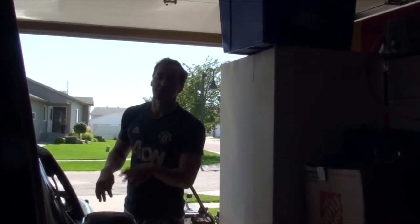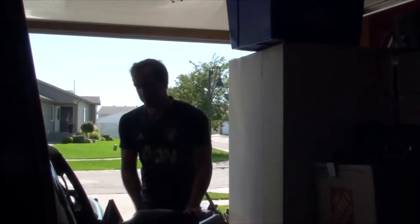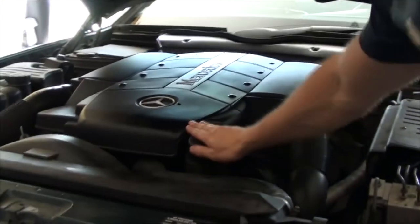Now before you lower the vehicle, putting it all back together, fire up the engine, make sure that you don't have any spurts of oil, any loose plugs or anything. Maybe hard to see, but looks like this is maintaining a nice seal and going underneath. We've actually done a really clean job, no drippage at all. Excellent. Let's kill the engine and put it all back together.